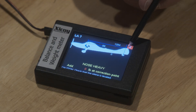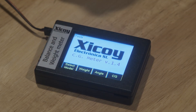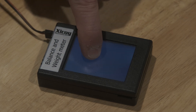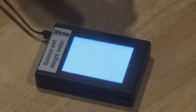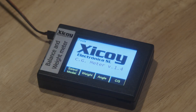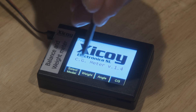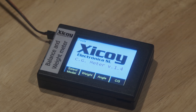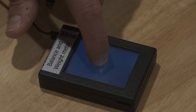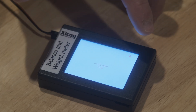You just saw me hit it with my fingertips and it seemed to work. But let's go ahead and reset this — I wanted to show you what happens if you screw this up. I'm just going to hit the screen a few times so it's totally not calibrated. As you can see, you can't toggle any of the buttons and there's no response from the screen whatsoever. So if that's the case, just remember: hold the screen down, apply power, you go into screen calibration mode, and hit the four dots.